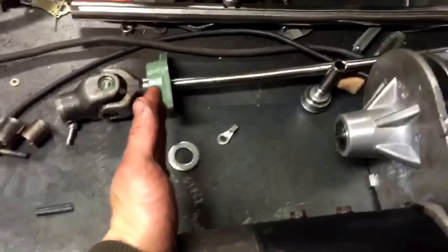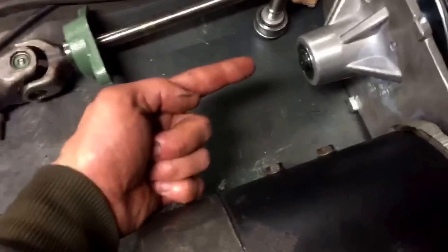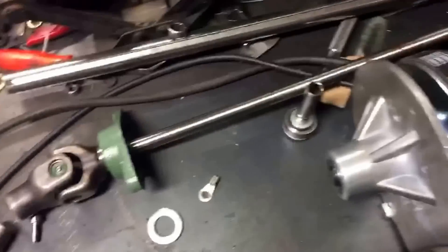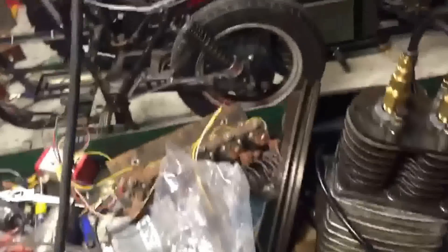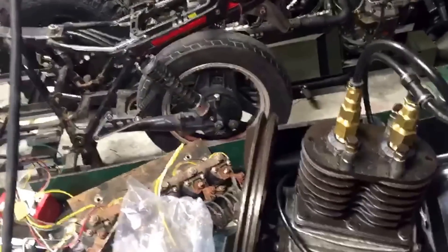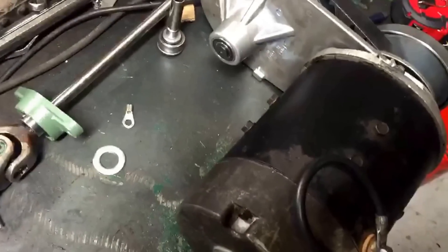As you can see, I'm about to build an adapter plate that comes out here and bolts to the pillow block, so the shaft will be running in and tying into here on into the driven pulley, and then it will be welded directly to the universal joint, which then ties into the input shaft going along into the rear end of the bike.